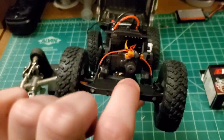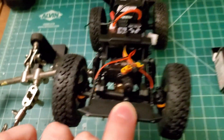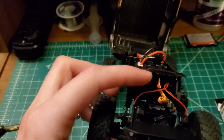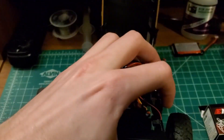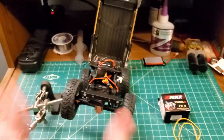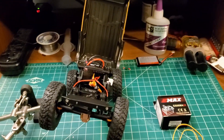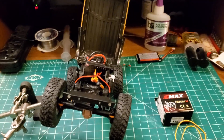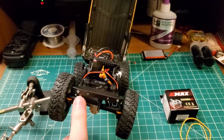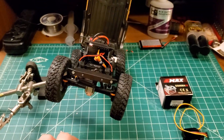I'm thinking you could probably swap it just to the front here. You could take the bumper off too and just pull it through. But I think it's going to be easier if I just drop the axle by undoing the shock here and over here as well. If I undo those, it'll let me just drop the axle nice and low and then I can just pull it straight out the front. I'll probably take off this screw here as well and pop this whole thing out without it being connected to the front tie rod. But let's see how this goes.